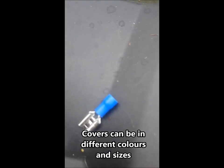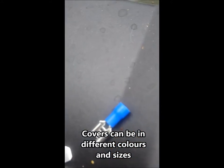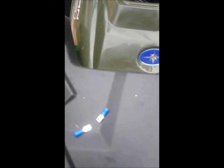Once you've done that, take the other end of the kill switch and solder on. Because these are crimp connectors, what I'd like to do is remove the blue cover, open up the end — it's quite a tight connection — put a little bit of solder in, tin the end of the connectors, and then solder it on and close it all up with a bit of heat shrink. I just find that easier. You can crimp them on, but at the end of the day you're going to be pulling these quite hard if you fall off a bike and you don't want them to come out. I find crimps slightly unreliable, so I like to solder for extra insurance.